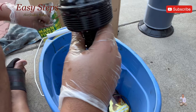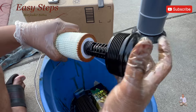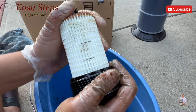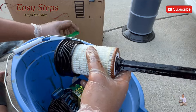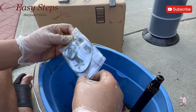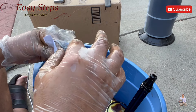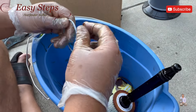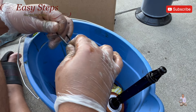Grab the new oil filter and just insert it, then squeeze the oil filter up until you hear it lock. Now get your oil filter o-rings and lube them up with some oil — it'll create a better seal and make it easier to open next time.